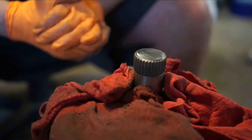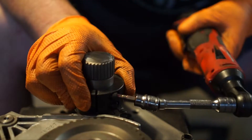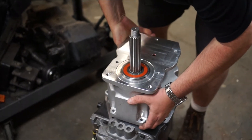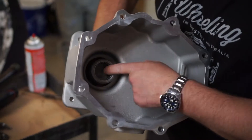The next process will be putting a locking collar to hold the fifth gear on the main shaft, since we no longer have a fifth gear nut anymore because we've cut the shaft off. The new input shaft via a spud shaft will plug into the adapter, and then the other side will fit the Land Cruiser transfer case.